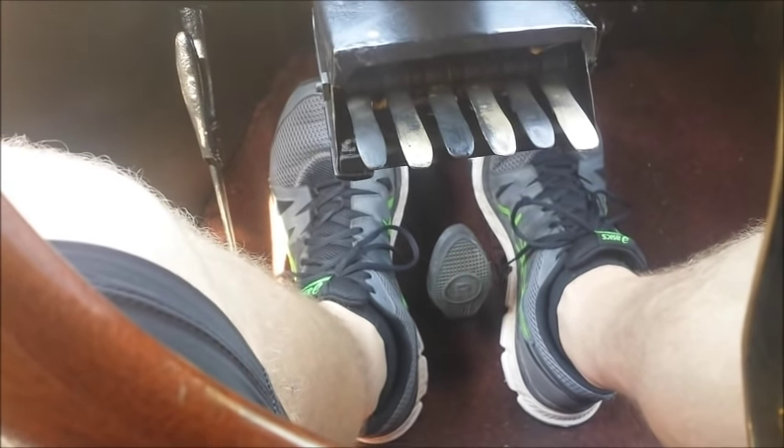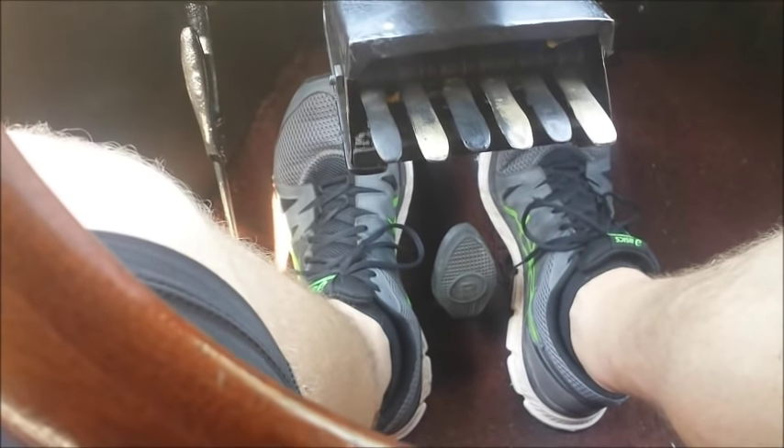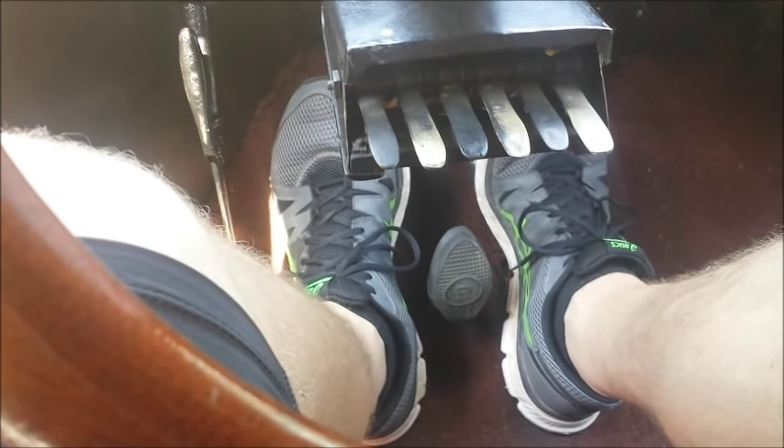When you come to a stop, you've got to float it right in the middle - that clutch on the left. You've got to float it with your foot or you're going to start rolling forward. Until you get used to it, you can always reach down and grab the handbrake, and the handbrake will put the clutch in the neutral position for you so you can feel it.